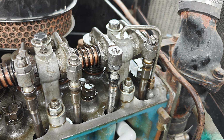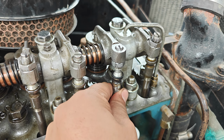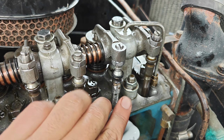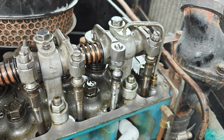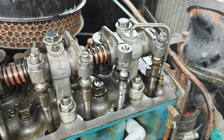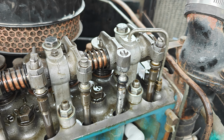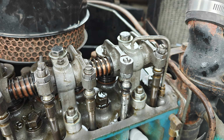All right, so this is the trust me, I'm an engineer part. I'm not sure what's going on. I tried to pull the push rod out, I couldn't. But what I did do was essentially the adjuster arm. I put the nut on the bottom side, gave me a little bit more length, and I adjusted it. So I'm gonna crank it on and see if the lifter's fine. It's just a push rod, for whatever reason, is shorter than the other.